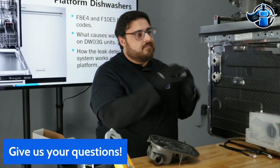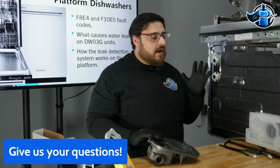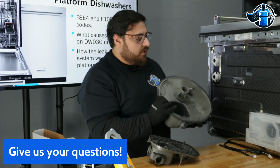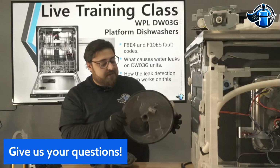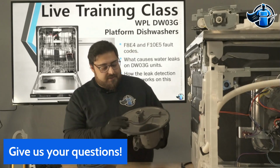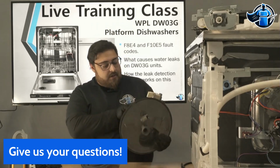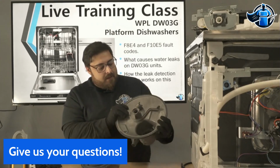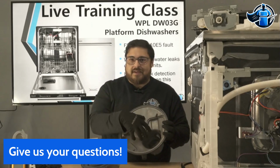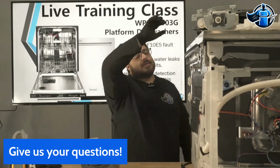Don't just walk away from it. Don't just throw it as leveling or anything like that. If you've got water in the tray, there is a problem. And just to show those that are not aware, this is the circle sump, the difference in the sump assemblies themselves. This one does not have a diverter in it. It's a cheaper model, but we're talking circle sumps on the Zoros that do have that kit for the diverter seal. That's what we're talking about on these circle sumps.